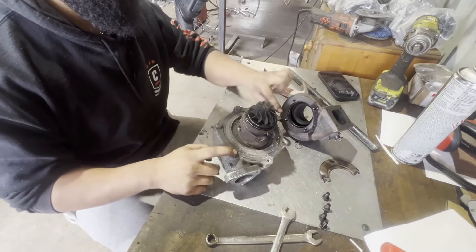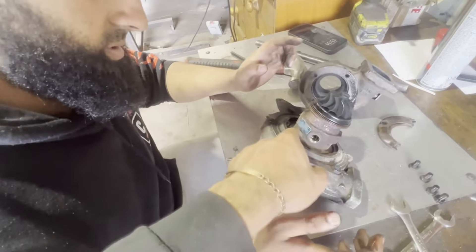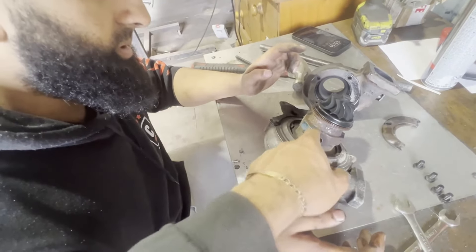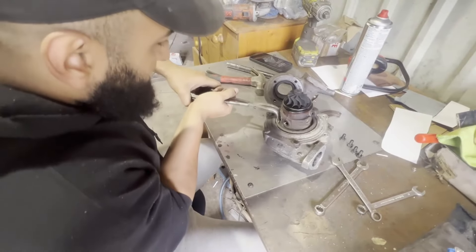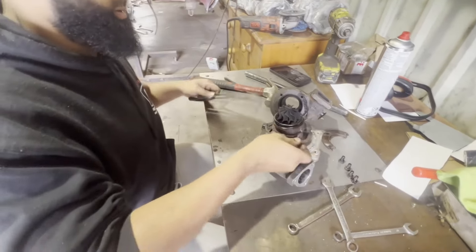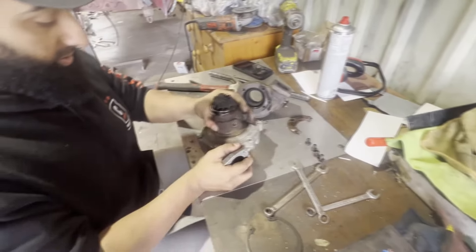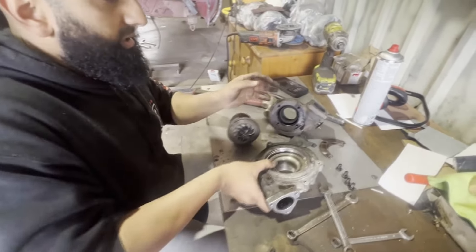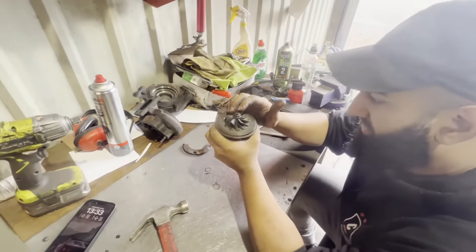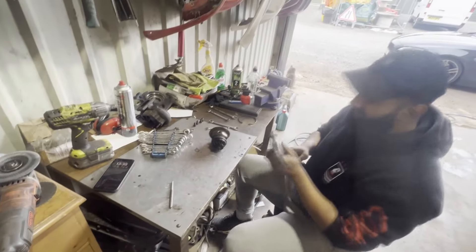Now I'm assuming we're going to do this? I don't like to do that. So we have the seal plate that goes between the compressor housing and the core. This is a separate part. I like to start with the snap ring in here that takes out the core from the housing, and then leaves the seal plate and the housing together. Do you have the snap ring pliers? That's it - nice first shot. Those can get stuck. You're having a good day, this turbo is treating you well. There we go - pull it. That's the core out. The part we're working on the machine now is the core.